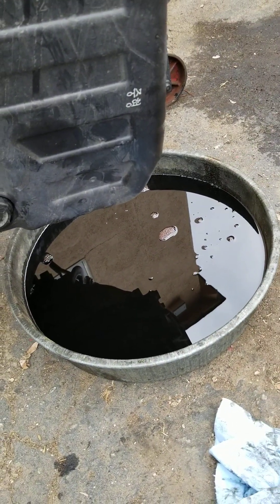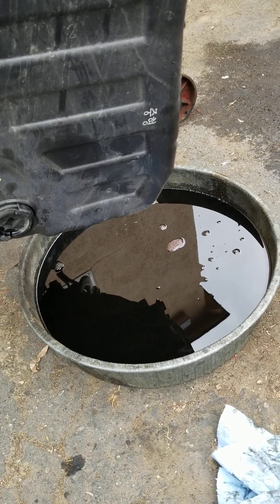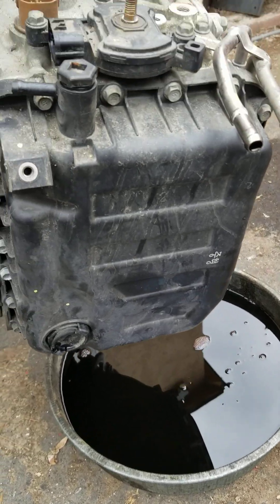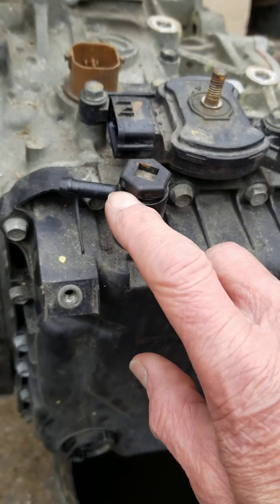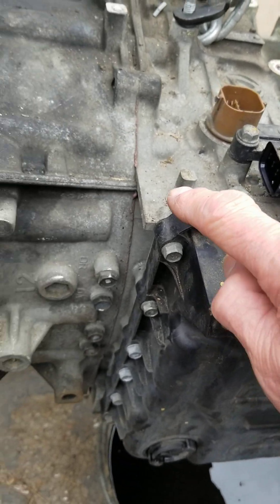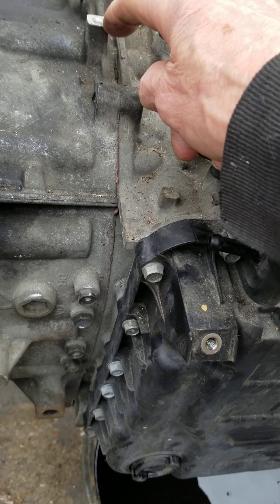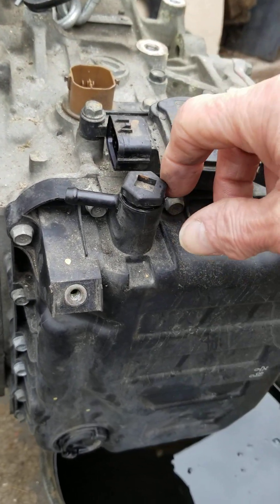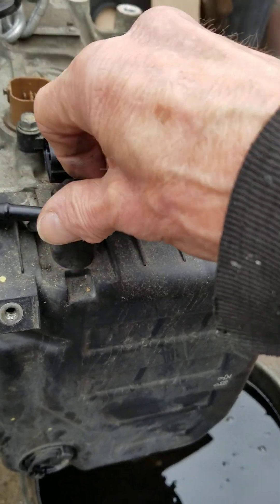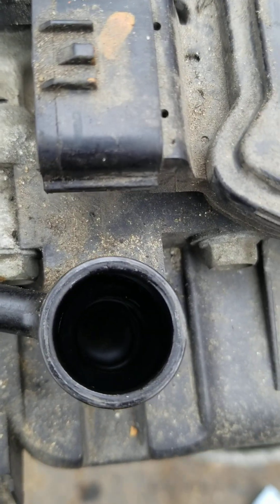All the oil went ahead and drained out. It looks like it's just about five quarts. This right here is where the vent tube is. There's generally a hose on here that comes over, and there's a bracket right here with a little breather on it. If you go ahead and unscrew this, this is where you fill the transmission from.